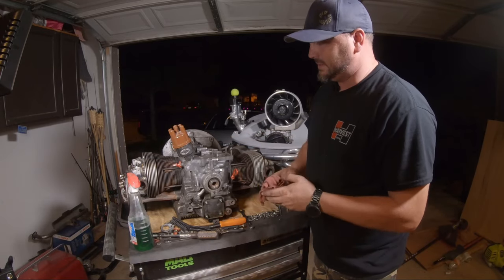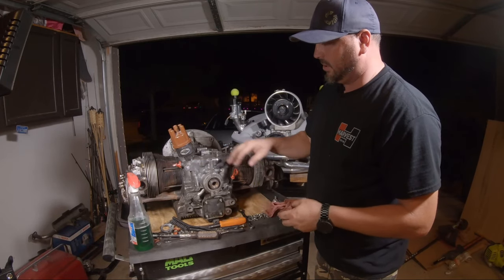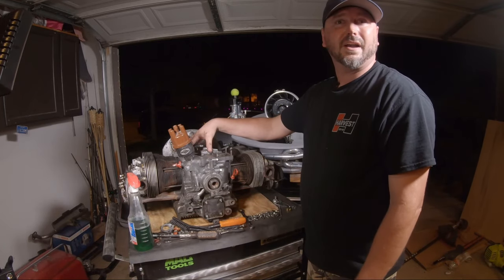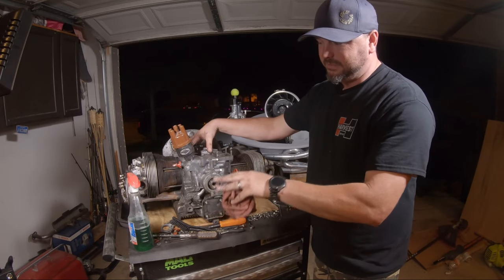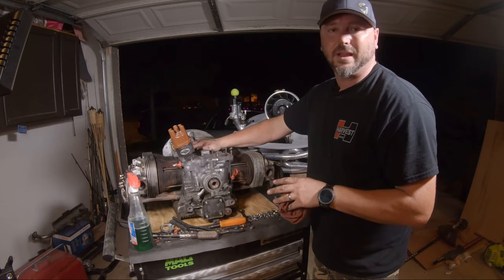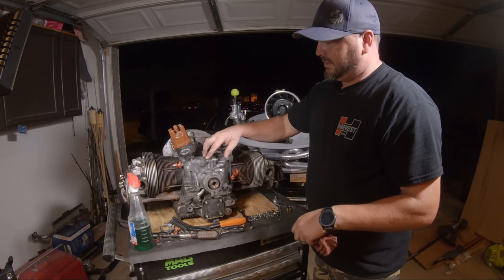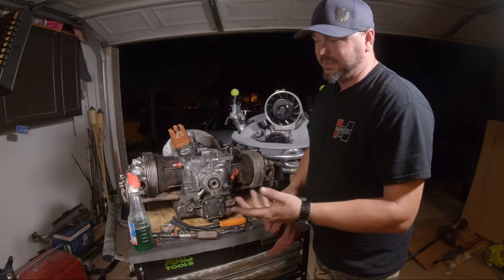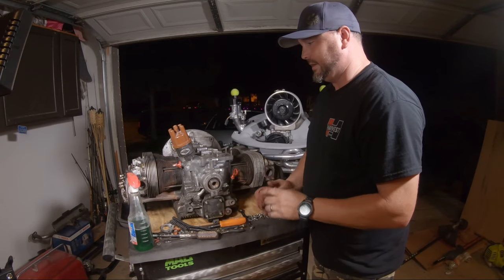You can see, basically you can buy a junky motor, and especially if it was in a running car, you can actually make it look pretty nice, pretty easily with a $5 gallon of green cleaner. It's nice, that stuff, because you can dilute it down and you don't have to put something so caustic on here that it's going to wreck the metal. Some of those really heavy degreasers can start to etch into the metal if you don't get them off all the way. This stuff's so mild and it's mixed 50-50 with water, so it gets the grease off without really hurting anything, and it works really good.